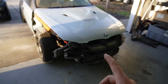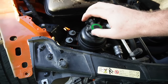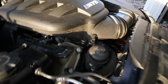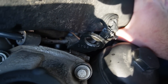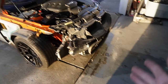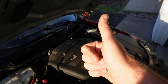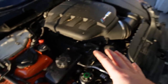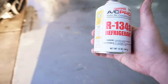It is running, but it's making a super weird sound. I don't think the power steering is working because the steering is super heavy. Let's pop the hood and top off the power steering fluid. Also found a slight coolant leak right here on the hose that connects to the top of the expansion tank — it might be cracked. After bleeding the expansion tank I'm not seeing any more leaks. We have brake fluid, coolant, oil, and power steering. The last thing I want to test is the AC.